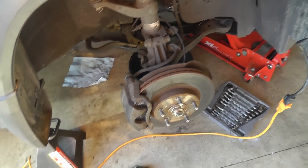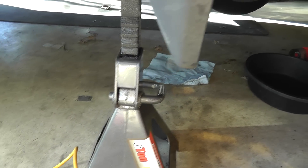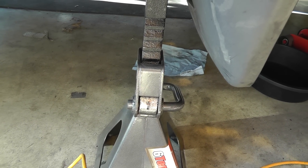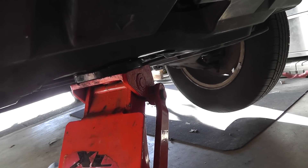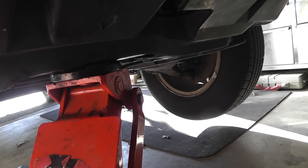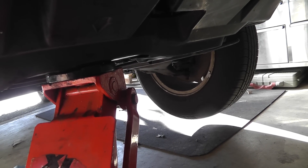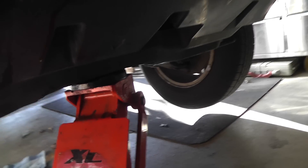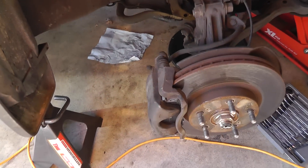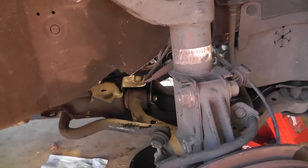Take off your right wheel and jack it up. I used one of those Harbor Freight 6-ton jacks — I know it's overkill, but safety's everything to me. I put another jack up front right where it's supposed to be. There's a little arrow that points right at the anchor point where you're supposed to put these jacks in the front. That's what you need to take off that sensor.